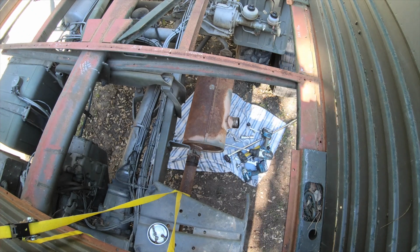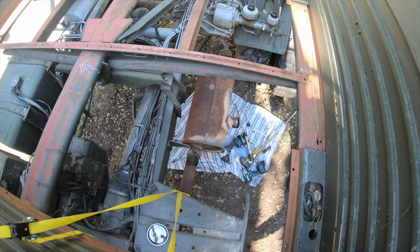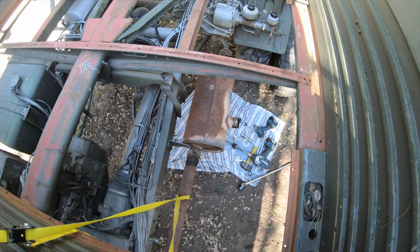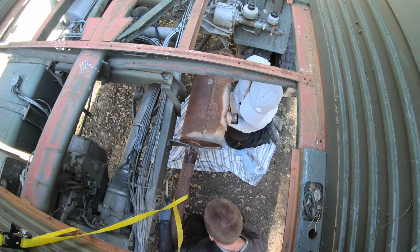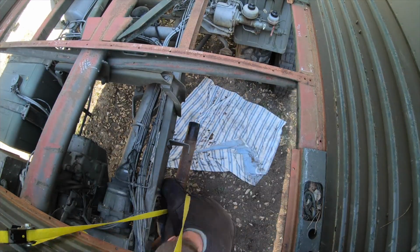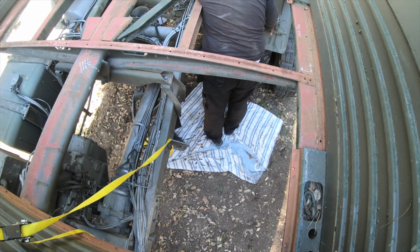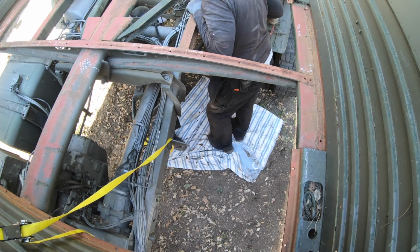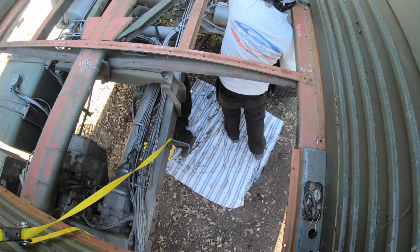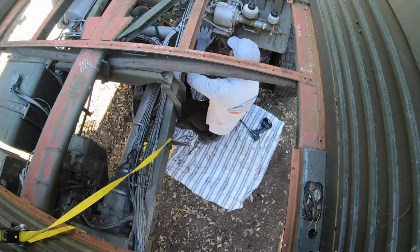In the end, you manage to unbolt one thing after another, and suddenly you realize that you're taking off the rear fog light so you can change the windscreen wiper because you haven't figured out how to unscrew the radiator hose. In this case, the exhaust is in the way of the bolts for the spare wheel. But you can't get the exhaust off because the rearmost bracket is in the way to slide off the silencer. To get the bracket off, I need to undo the 2 bolts on the frame, which are hidden by the load sensory gubbins. So we need to take all of those off.